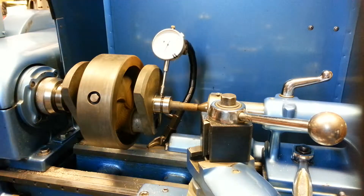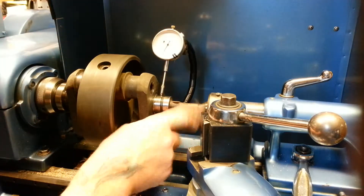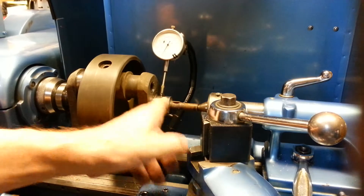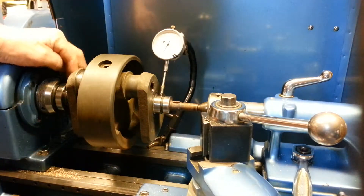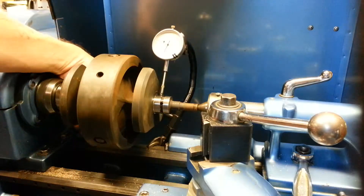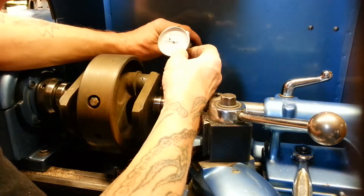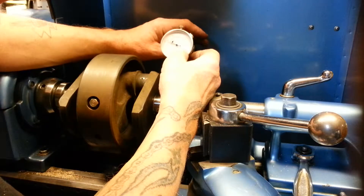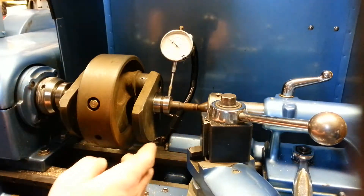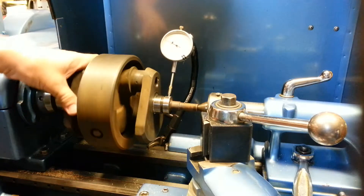We're back, and now we have the crank mounted in the lathe. I have it in a collet on the lathe, and on this side I have it in a live center. What I want to do is check the main bearing run-outs — where this side rides in the case and this side rides in the roller bearing — to see how far the run-out is. This side is really close, looks like it's within a thousandth. I cannot fit this crank in my truing stand because it's too wide, and by right I should have this end in the center on the end of the shaft, but I've done it this way before and have excellent results.